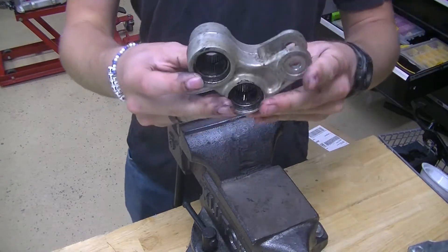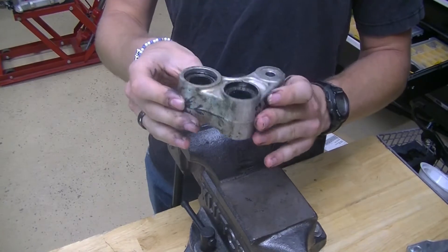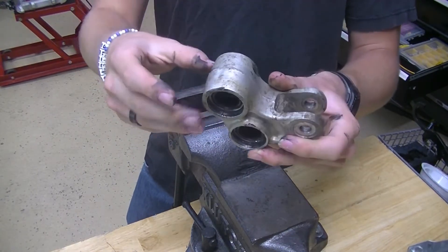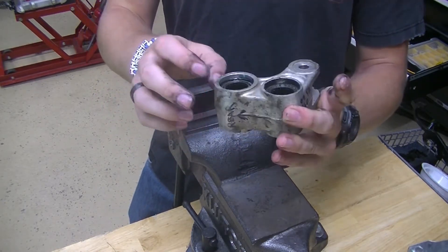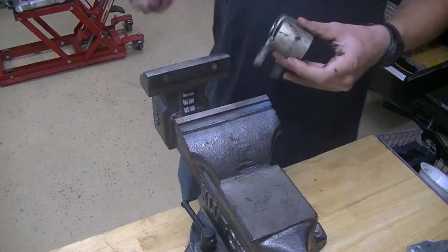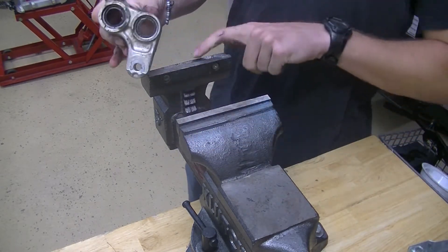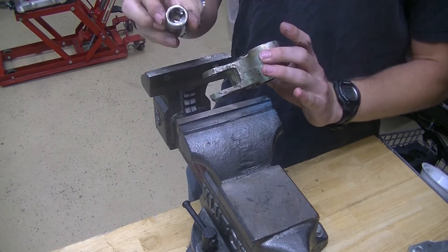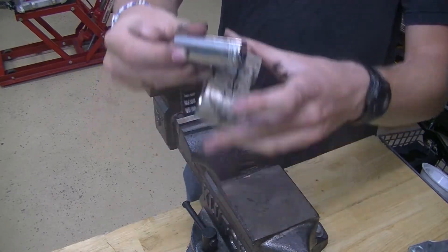Now we've gotten to just the bearings. The secret weapon to this part specifically is there's no lip in the middle — it's just a hole that goes straight through. So you have to set the gap of the bearings when you put them in. But for getting them out, all that gives us is a really easy way to do that. We're going to open up our vise all the way and set it so the end of the vise is going to push on the socket itself. In our case, this is a 19mm. We're going to use a deep well because it'll go all the way through with a little bit of space left.